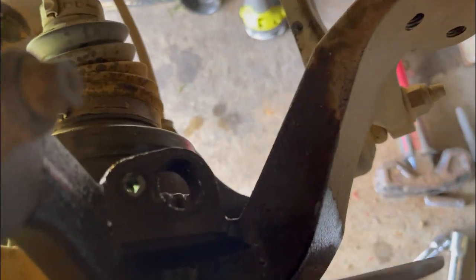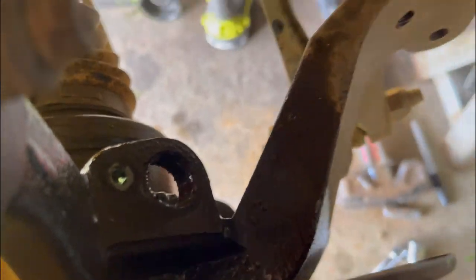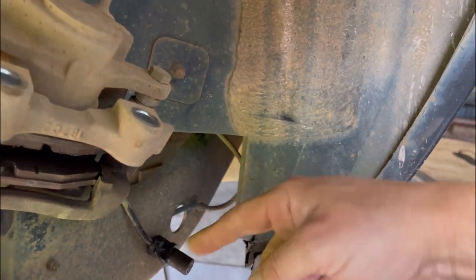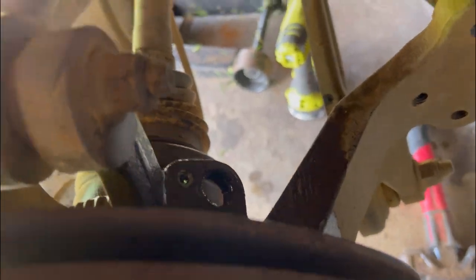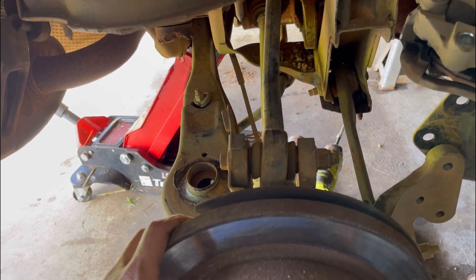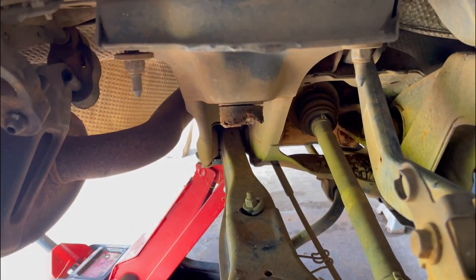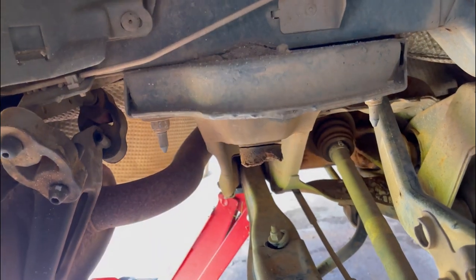Why is it that the small jobs seem to be the most time-consuming? Got the wheel speed sensor out — it was just full of crud in the end. You can take the back seat out and unclip it from inside and pull it out that way, leaving it bolted in, but I wanted to get it out and give it a good clean anyway. I'm probably going to clean this whole cradle out while it's out — clean it up just so I can put it back in and feel good about it when it's all clean. Just got to do the other one on the other side, then rearrange the jack, take these four bolts or nuts off, do the main one, and we'll get it out.